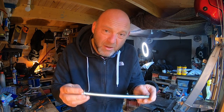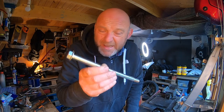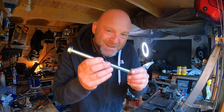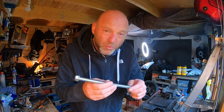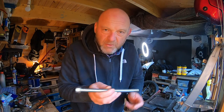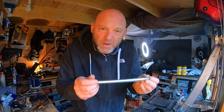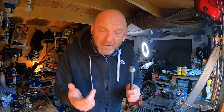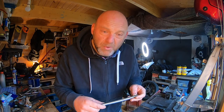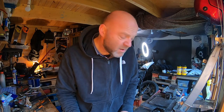I'm also going to put the swing arm back on with the new shaft bolt. Unsurprisingly, this shaft bolt spindle — whatever you want to call it — is actually suitable for many different models of bike, which is applicable to all motorcycle manufacturers. They have common parts, which makes economic sense. So grease, grease, grease all over, get it all aligned, tighten it up on the engine mounts, then put the rear shock absorber in.